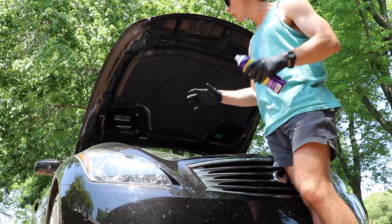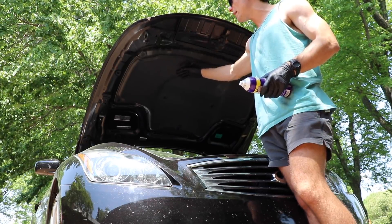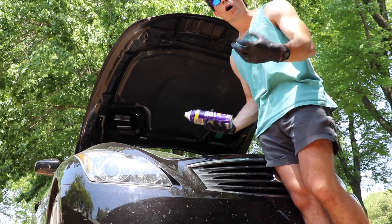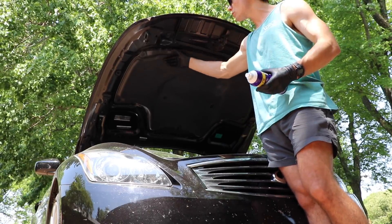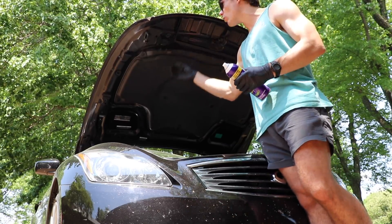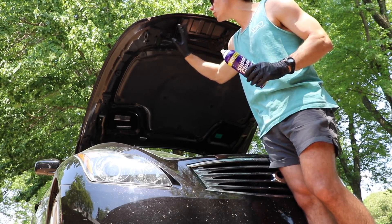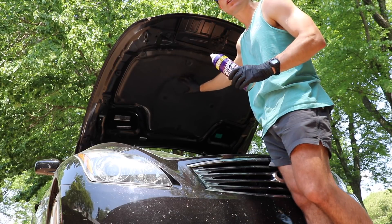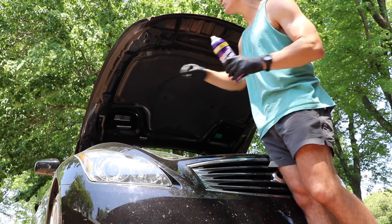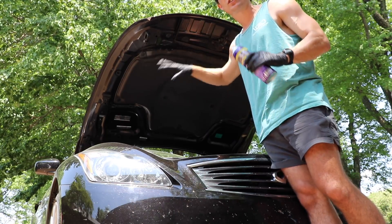The only cautionary thing to know is that the hood blanket — in older cars it's more of a blanket, hence the word — it absorbs water almost like a sponge. These newer cars have more of a synthetic, cardboard-ish material that won't absorb a ton of water and is very thin. I don't have to clean it as much as I need to address the paint, though I'll certainly scrub it down. You have to be careful because it's a fragile material — I compare it to paper mache — so I kind of leave it alone.